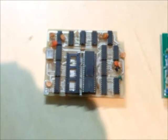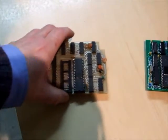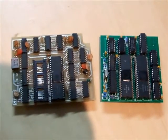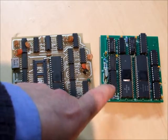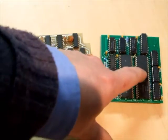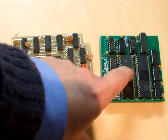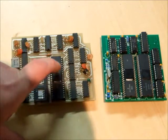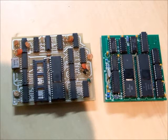What I'm offering now is a replacement. My new one is much simpler — it only uses 9 support chips, the double density chip, and the 1771 out of your expansion interface. It's made up out of new parts, it's completely compatible with the old PERCOM, and can be used with any old Model 1 operating system that supported the PERCOM doubler. That includes LDOS 5.3.1 and NewDOS 80, which are the most common ones. I'm sure the other ones work perfectly as well.